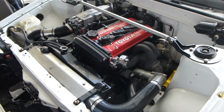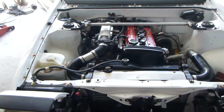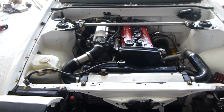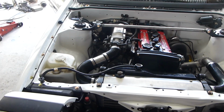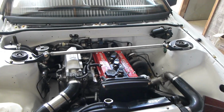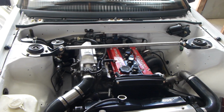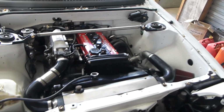So it's a bit of heavy load driving really. Not heavy, but loaded up so the piston's bedded in a bit, but not revving it right out and not going crazy. So just normal driving really. Probably do maybe a trip to work or so, a couple of trips. And then drop the oil and whack the new stuff in, put a new oil filter in it, and it'll be good to go.